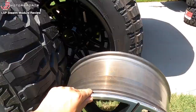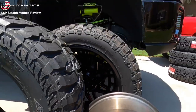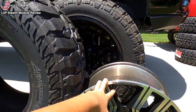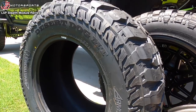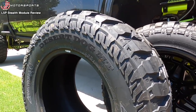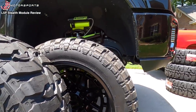With that being said, I've always wanted to try the Bubba look. This is actually what I wanted to do before I put the McGaughy's lift kit on, but now that I've got a 9-inch lift, I'm putting the stocks on with 38s. I really could have gone with 40s, but Armstrong tires didn't make 40s. With 38s and 2-inch wheel spacers all the way around, I know for a fact I'll be clearing these tires no problem.